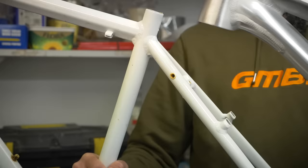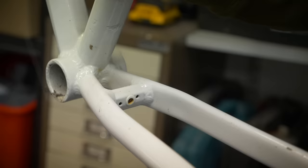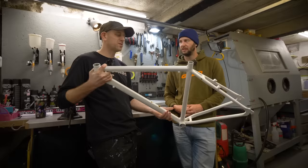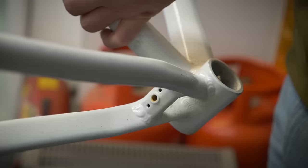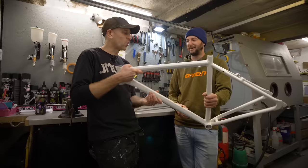Would you need to take this one back to bare metal? This one I probably would because it's got rust on it — it's got some chips and bubbling of the paint. When the paint's in not such good condition, the best thing is to take it all the way back to raw. The easiest way to do that, which I totally recommend, is to find a local sand blaster or media blaster. Speak to them, make sure they're happy at blasting frames, because you don't want someone to destroy your frame. Make sure they're going to be plugging the thread holes. It's normally about 30 to 40 pounds and it will save you a whole world of pain compared to sanding or paint stripper.